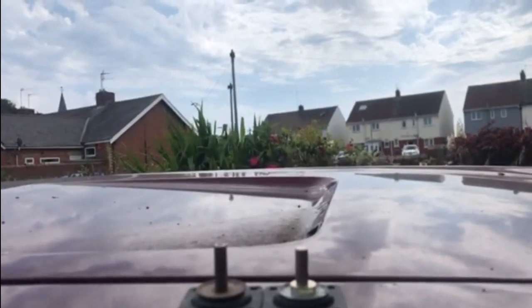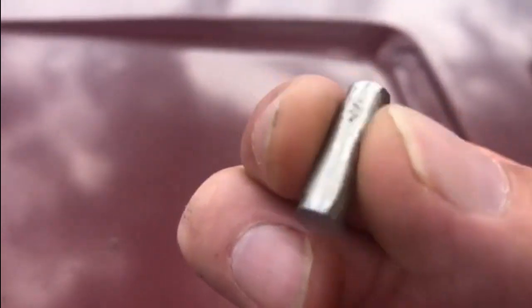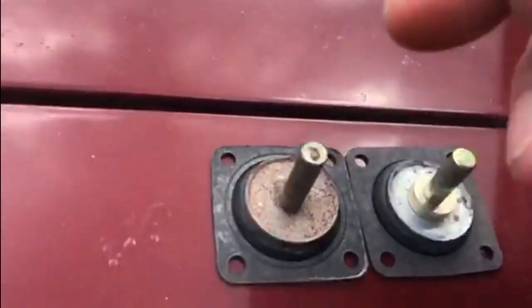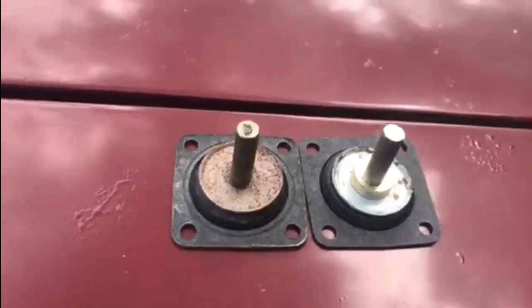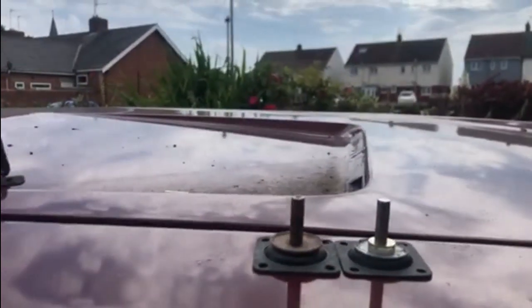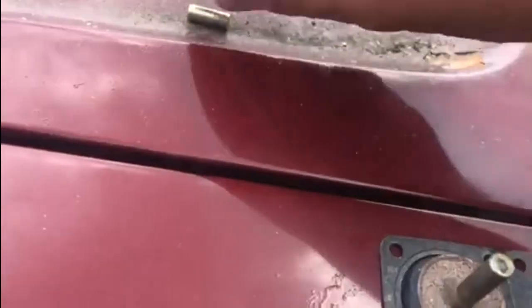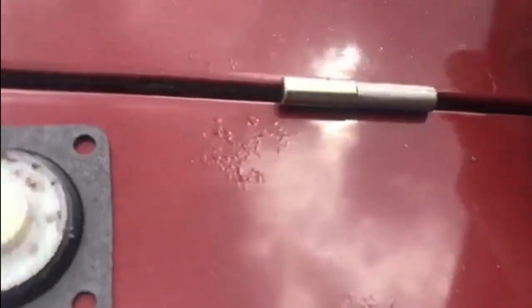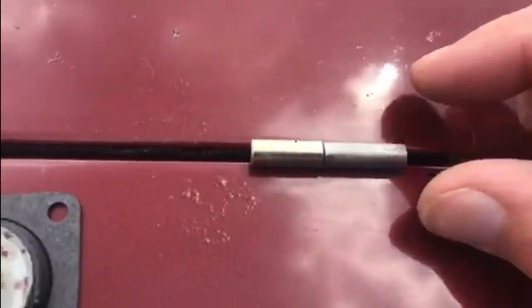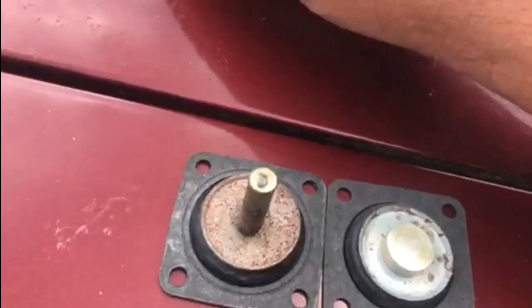In order to get around that, I found a bit of metal bar in the shed, cut it to size - it needs to be cleaned up a little bit. We're going to take the new diaphragm off, stand the bar on there, and they're both the same height. It just so happens that this bar is a very similar diameter to the new rod that came with it. I'm not worried about fuel leaking out because this doesn't sit in a seal anyway - that's the sealing part.